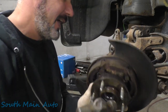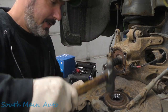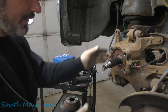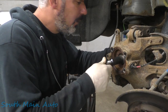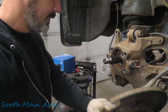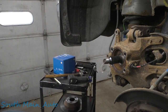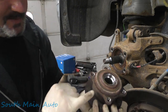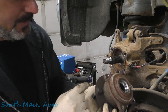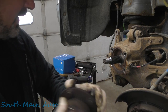Speed sensor reads off the axle — look at that! It's not every day you get this lucky in the PRNY. Wow, that's it. My life is complete — I was planning on waging war with this fella but now we don't have to. It's kind of interesting: it doesn't really set into the knuckle; it looks like it sits just on the edge. Yeah, it has just a very slight taper — that's why it wasn't seized. That's really cool. Great design, Hyundai. You can see it only touches just a little bit around, just enough to center it.